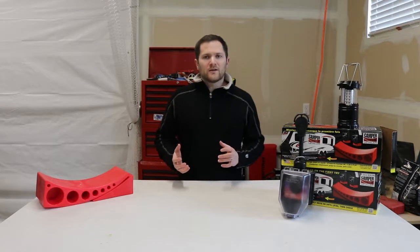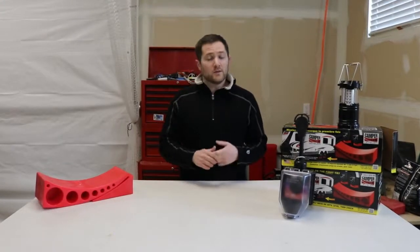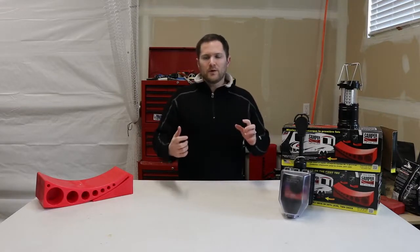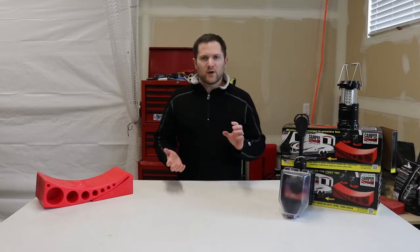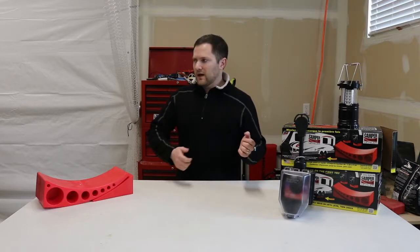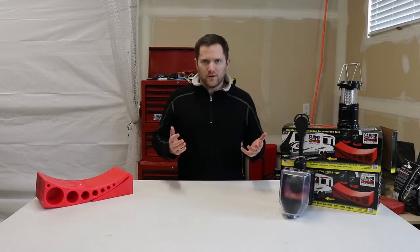How do you balance a travel trailer tire? You buy your tires at a reputable dealer who will balance them. Typically you pay a mount and balance fee anyway, so you might as well get them balanced. They put them on a machine, the machine spins around and tells you where to put weight — you place weight on the opposite side from where the manufacturing imbalance is. It has to be done on a professional machine; you can't eyeball it yourself. But it's fairly simple, cheap, and easy to have a tire dealer do it for you.